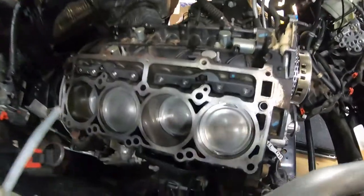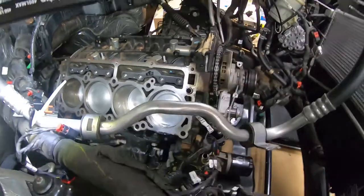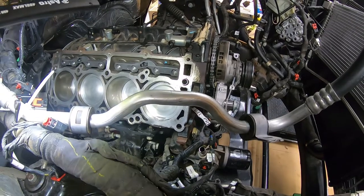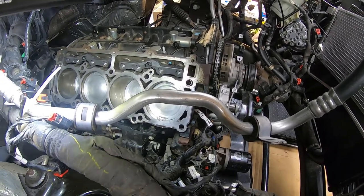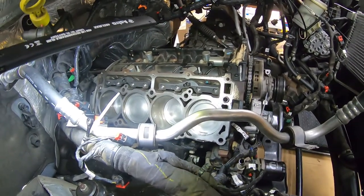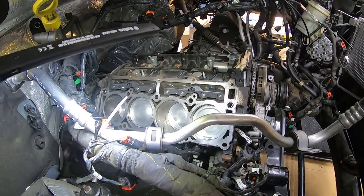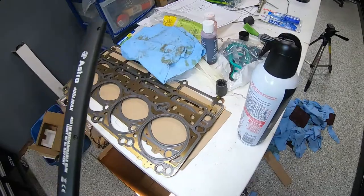You may not see it well on camera, but there's a sheen from the oil on the cylinder bores from all that wiping down. I'd rather have some level of protection than nothing — it will mean the engine may smoke a little when we first start it up until it burns that oil off, but it'll be fine. Next we're going to get our head gaskets in place and prep for placing our cylinder heads.